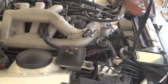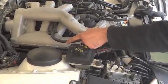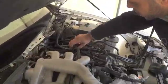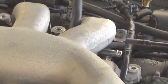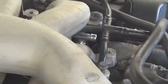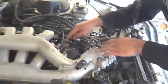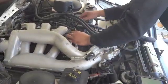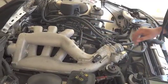So hopefully that's out of the way. Now this one, which is like a dual hose, you have to take this black clip off, which I already took off, and that releases that whole line and you feed that through. Okay, just like that. Now move these lines out of the way. And you have your PCV inlet tubes here, and we're going to leave that. That'll be a step once we reach the valve covers.